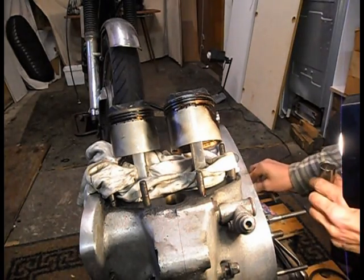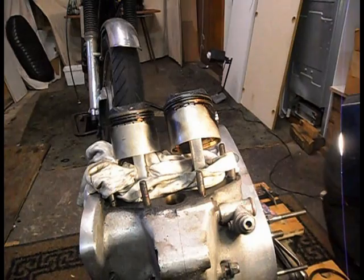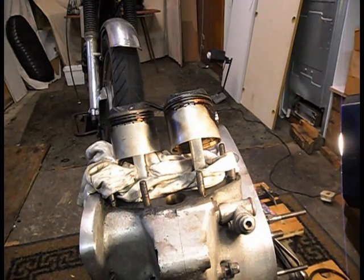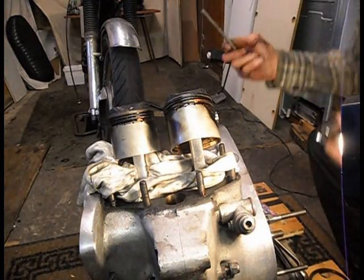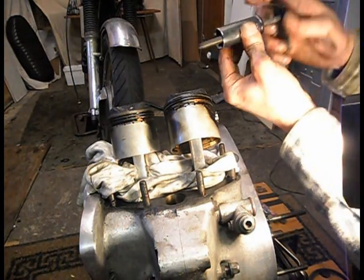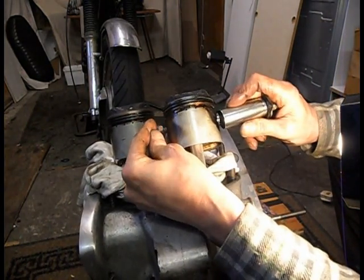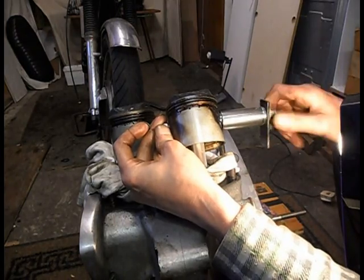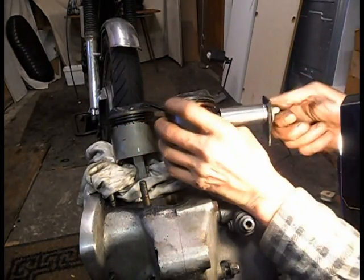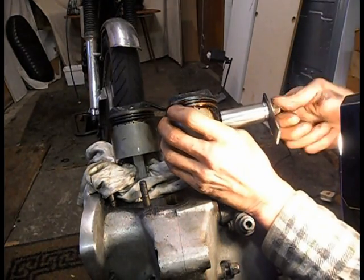Yeah, just felt it going tight. Alright, on the wide bit, let's get a bigger one, a good one. Right, using a 19. I get through. See, I'm just using an ordinary nut at that end. There's a self-locking nut on the other end of this. And these, as we know from my last rebuild, these con rods, they're two different con rods.